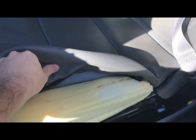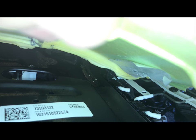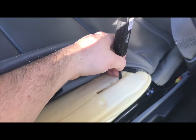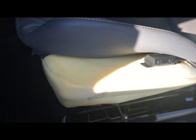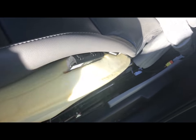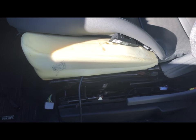Once you get this corner of the leather open, you'll see right here is where the sensor goes, and there's a hole that allows the cable to route out through the bottom and through the pan. You can see another set of wires down here — that's for the other sensor. When running the new sensor, feed the connector through the seat first, not the vibrator through the padding.